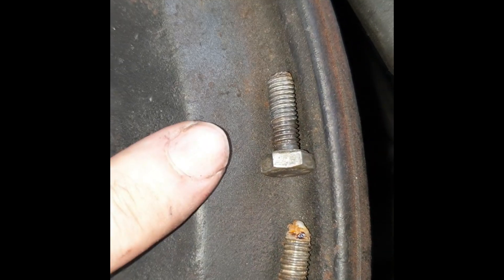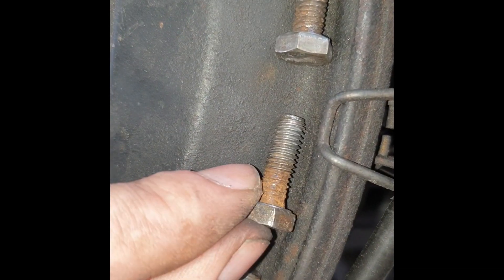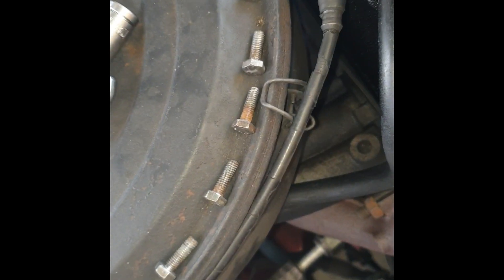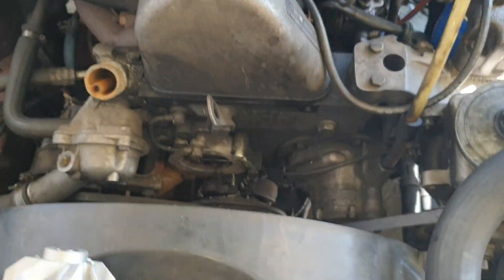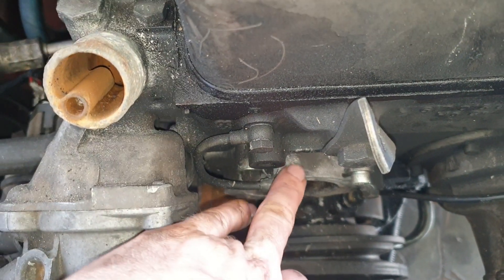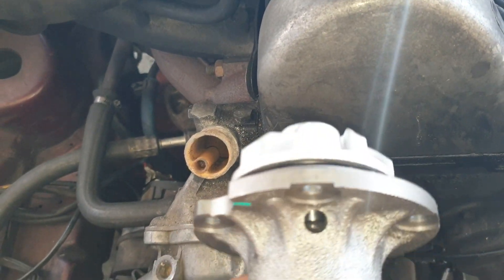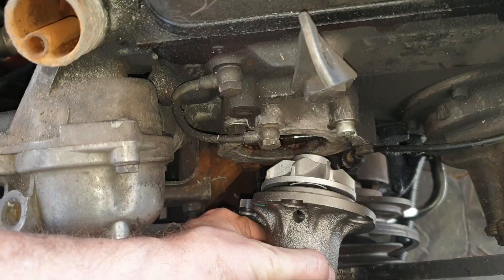I cleaned up the bolts as best I could. This one is really not the best — I think I'll have another crack at it. They all turned out okay enough to be usable, at least temporarily. I will get a new set, but I need to use the car today. We've got our gasket. With the gasket you'll see it's got this little notch — that notch is for the section with the little tube that links the head to the block. When you put this in, it matches with the notch and all the holes line up. I'm going to put the gasket on, sit it on the ring, put one bolt in to center it, and in we go.